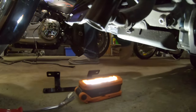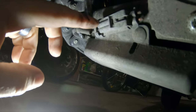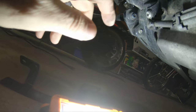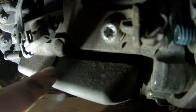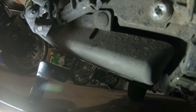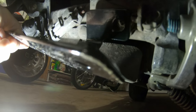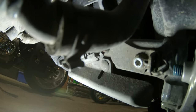I'm going to crack into the hardware, figure out what tools I need, figure out the plan of attack, and pick you guys back up. So to show you where we're at — we're obviously under the bike. Here's a plug which I assume is for the oil cooler, and then there's a Christmas tree attached to it. I just grabbed my little pry tool, popped that out, and that reveals a screw — both are T40 — which we'll pull those out, and then this bracket will mount right where those bolts are.